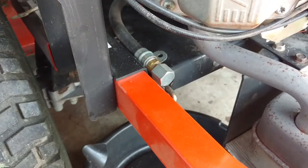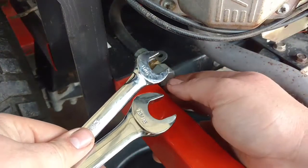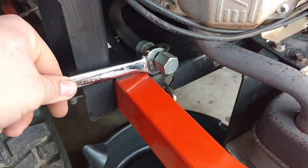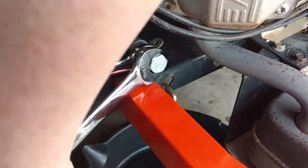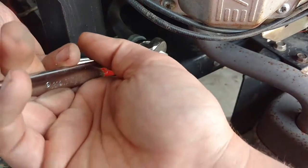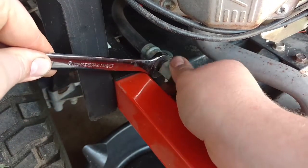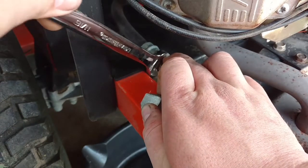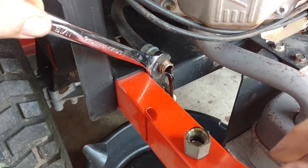Here we are at the side of the engine. This is your drain plug right here — it's on a little hose and it runs to the side of the engine. In my case it's an 11 sixteenths to hold the line still and a 13 sixteenths to break it loose. I prefer — and I do this for all my customers and my personal stuff — to run the engine and get it hot, at least warm. Be careful of the exhaust. This helps the oil flow better and drain faster. Pull the dipstick out so it gets some air and can vent.